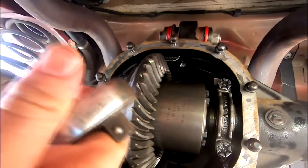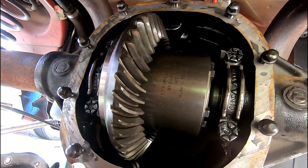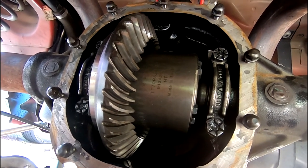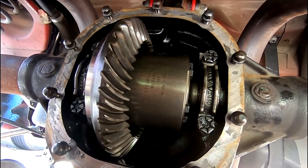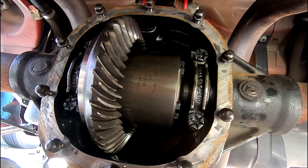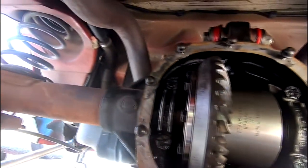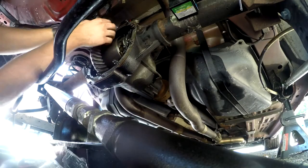I have a small amount of trust issues with my torque wrench. One or two of the bolts when I was tightening that didn't feel like they would click. I backed off a couple times, and then all of a sudden it clicked, indicating it's not acting at 100% right now. So I'm really trying to make sure I don't jack anything up and strip anything out. So we're going to go ahead and go for 90 first, make sure we're good. Maybe even 75, make sure we're good, then bump it up to 90. So, yep, that's what's up next, guys.